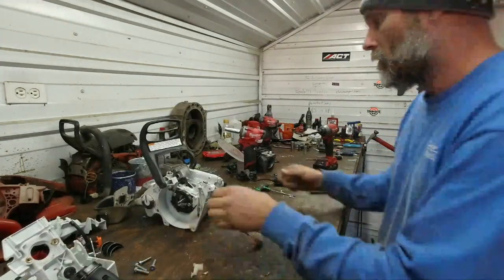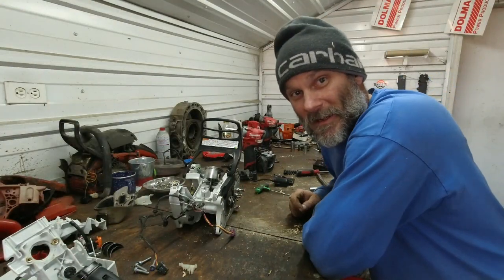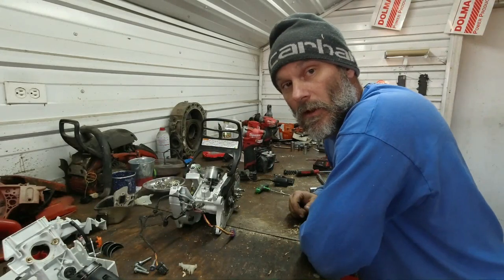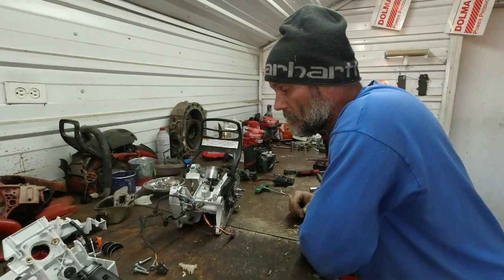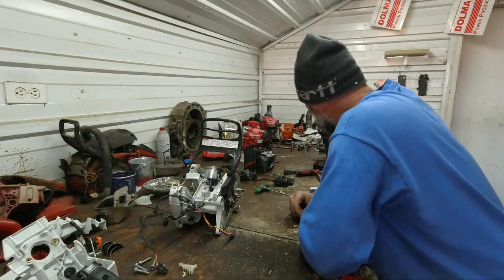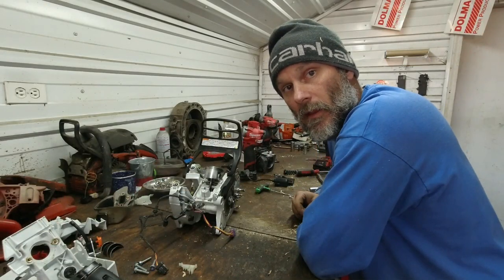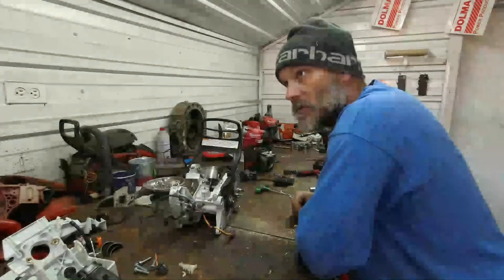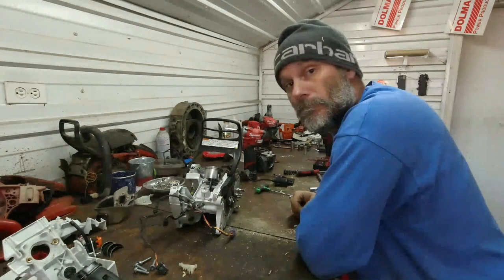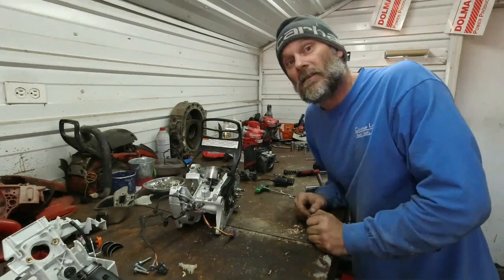So, yeah. Thoughts? Kind of a tech geek, so this is neat. Neat to see. I'm going to pull the rings and put my timing wheel on it and see where we're at for port timing. And it looks like all the ports are extremely small. And the cylinder quality looks amazing. I'll see what the squish is, and I don't know, maybe I'll make a video on that. Who knows? Maybe I'll just port it, test it, port it, have fun with it, sell it like I usually do. If you made it 38 minutes into this, thanks for watching.